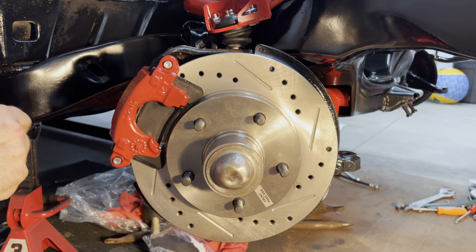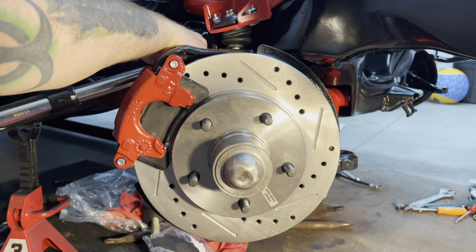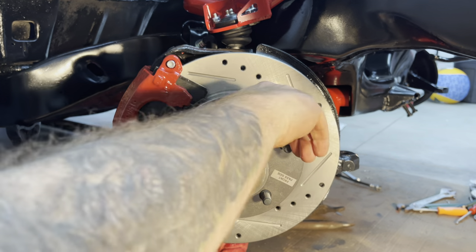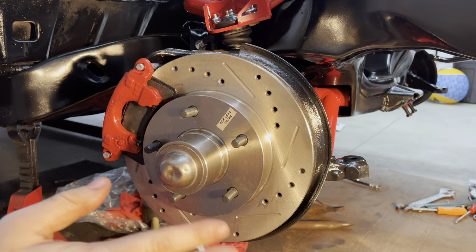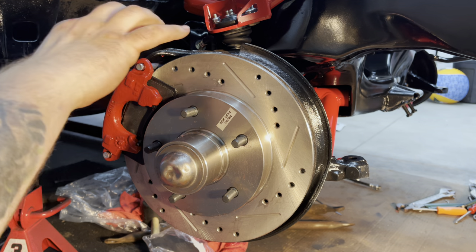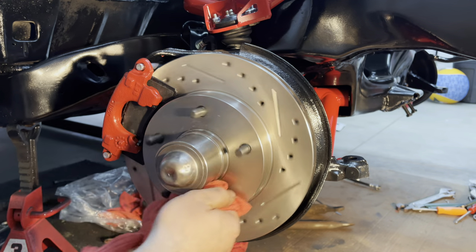Okay, that's 35 — all set to go. I just wanted to share what I ran across, because I couldn't find anything explaining why the brake calipers weren't going on the spindle. It was because the pads were too thick. To get cross-drilled and slotted rotors, you need at least a minimum of an inch and a quarter thickness, and the stock ones are only an inch. PowerStop's tech line guy is super helpful and very knowledgeable — if you have any issues, call them. This is what I ran into and it works A-OK.